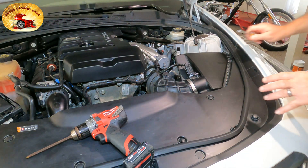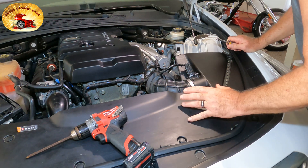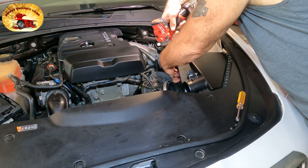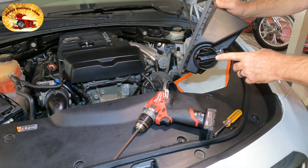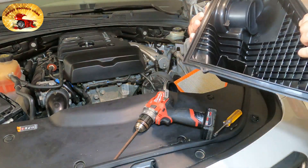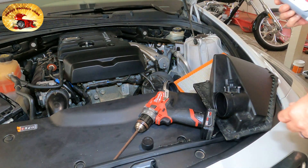This is something that a lot of people forget about — we've had a lot of questions on it. This should be done every six months exactly this way if you want to keep your car running good. This is your mass air flow sensor. It's a very delicate piece of electronics — you do not want to use electrical cleaner to clean it. This is all you want to use right here. Julio, tell everybody where all the tools are located.